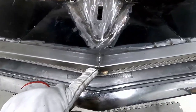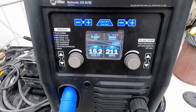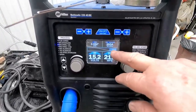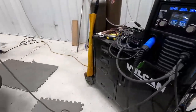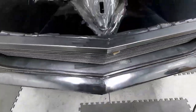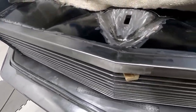So I went ahead and welded that seam before I pulled it out. I used the MIG welder for that — that'll sand right off. Here are my settings. When I MIG weld I go a little hotter — that's the 20-gauge setting, but I'm using 22-gauge material. Just a personal preference. I'll go ahead and sand that off. I used the 80-grit disc and scotch brite over that. That's ready to paint.